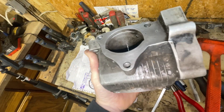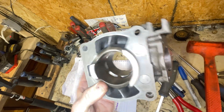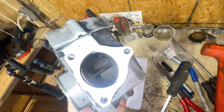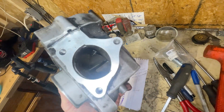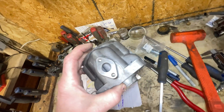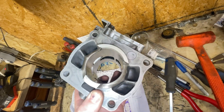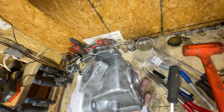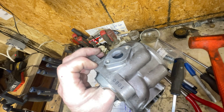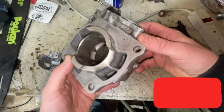We're going to do some cleanup work to the lower and upper transfers and polish this exhaust — do a much better job than the last one. Last time I just raised the exhaust roof and didn't really do any polishing. I want to clean up the boost port and do a little bit of work in there. Eric doesn't really say anything on this cylinder doing that, but I'm definitely going to get in there and clean it up.